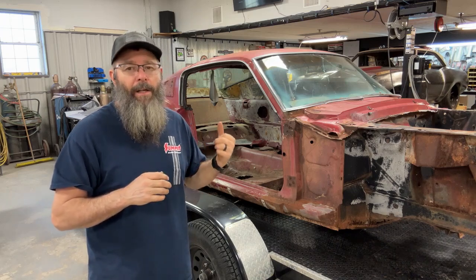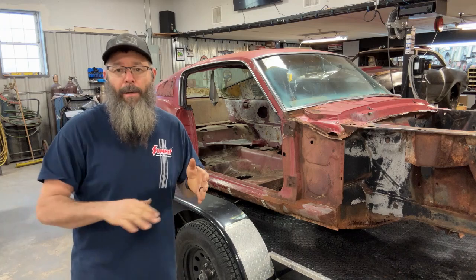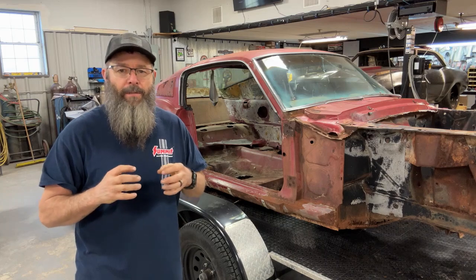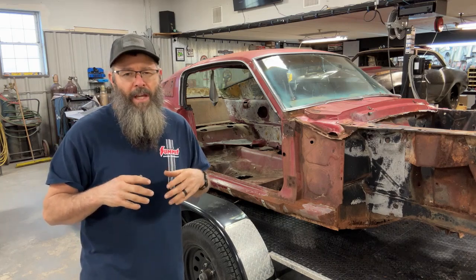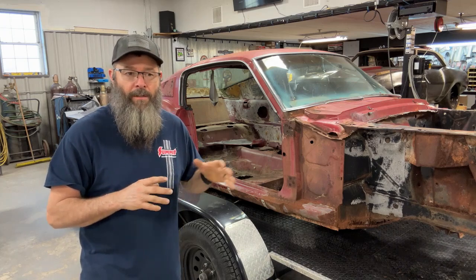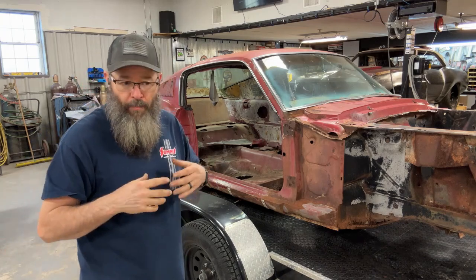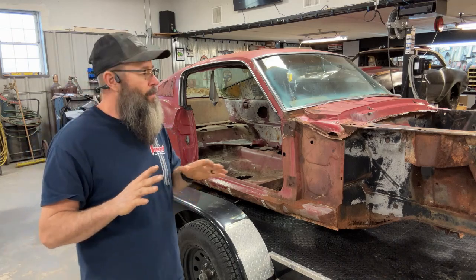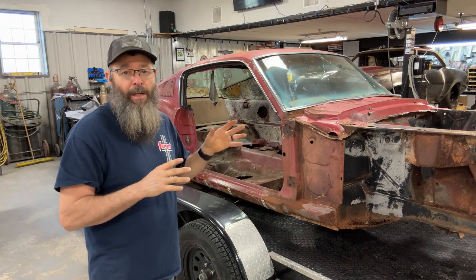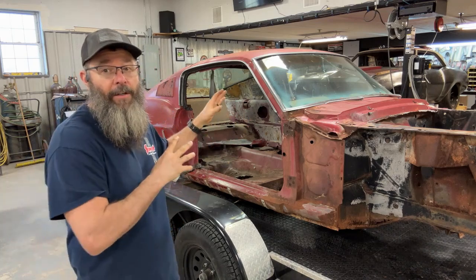We were gonna run the 10-speed electronic transmission in this car, and I actually ordered the chassis for that. The crossmember came in for that 10-speed transmission, but I'm a little concerned. I'm hearing that there's still some bugs that they're working out with the 10-speed. And the transmission controller, I don't know that they fully have developed a controller that works it yet. So we've decided to roll that back to a 6-speed automatic. We know we can get standalone controllers for that transmission, so I feel pretty comfortable there. But like I said, there's gonna be a lot of one-off stuff on this, I think. Not necessarily one-off, but for my shop, this is definitely new territory.